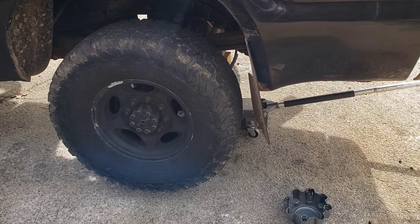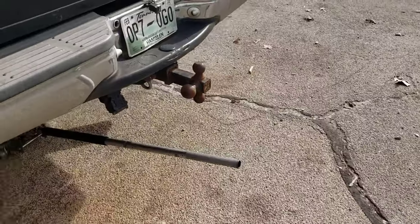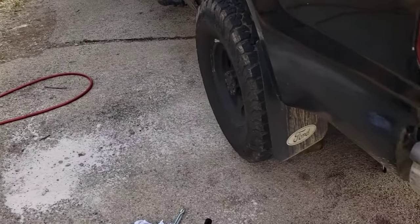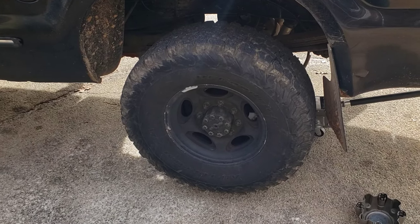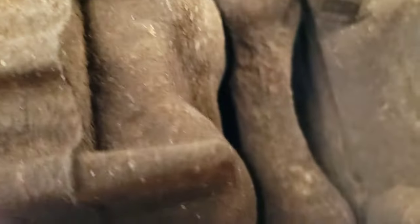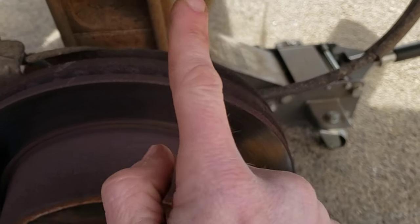Step one: raise and support your vehicle, put it on blocks, put it on jack stands. Don't be a fool working with a jack. Next step, remove your tires, and then you're going to remove the brake caliper bracket. You can leave the caliper attached, and then we'll go from there. Once you have your tire removed, go to the brake caliper bracket and remove the two 18 millimeter bolts located on the back side of the bracket. Get that removed, get your caliper tied up, and then remove your disc, your drum and hat.